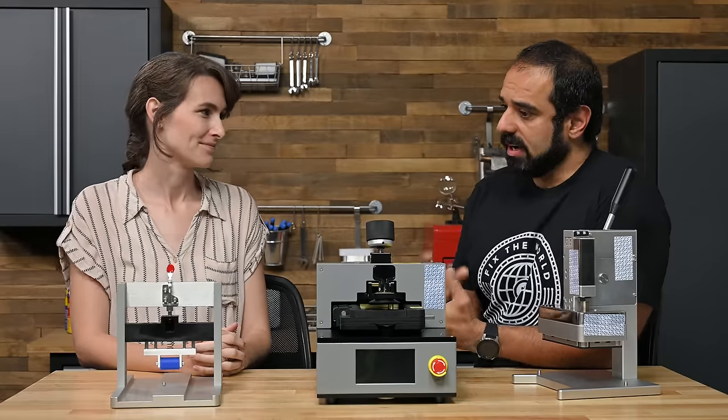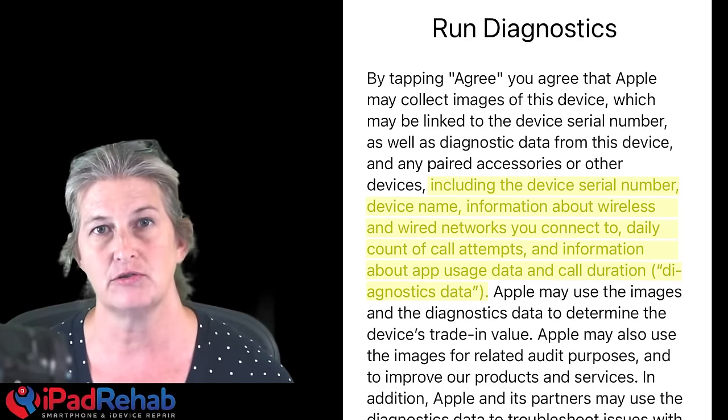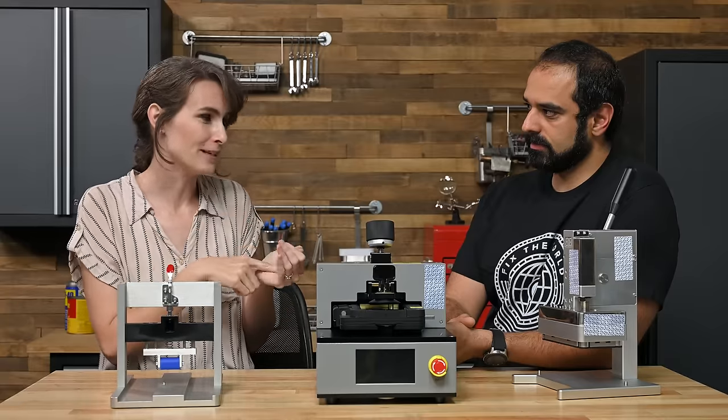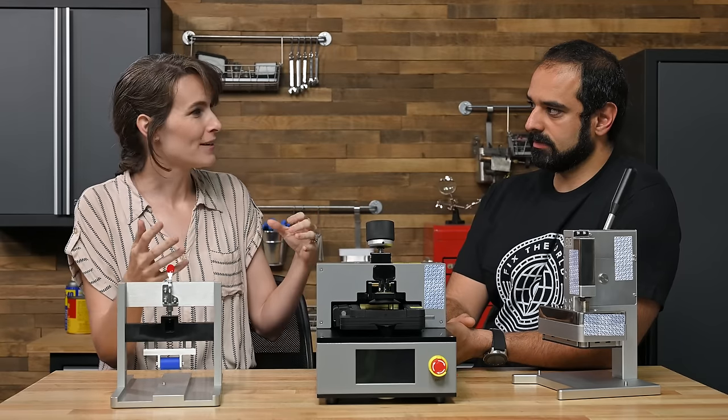Let's talk about privacy for a second. Our friend Jessa did this whole process — she got right to the end and then Apple gave her super invasive requirements to scan her call logs, scan her phone, and so on. What is this about for a company so obsessed with privacy? I'm actually super glad you brought this up because I think this is a mistake or at least an oversight. This is the full suite of diagnostic tools that the Genius Bar uses to look at anything that goes wrong with your phone — and this is not relevant at all to battery swaps. That part of the software is never going to be used for verifying your battery or your screen, but it exists out there. Apple is doing the right thing by warning you about it, but they are not doing the best thing — which would be sectioning off that part of the diagnostic software and just putting the parts pairing scanning in there, which is the only relevant part for this kind of repair.